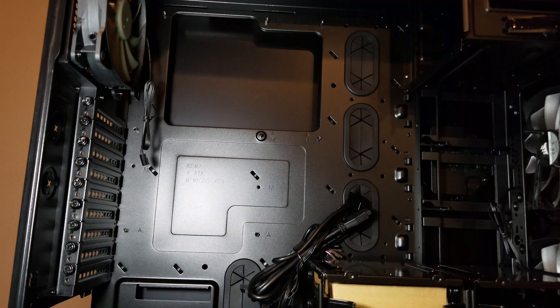Another thing to be aware of is the size of the opening at the top of the case — can you fit a cooler and secure it without taking everything apart? Up here there are openings that allow your cables to come through after the motherboard is installed. That space above where your motherboard goes is where your cable openings are, which helps with cable management and lets you route them through the back of the system to hide them and make everything look cleaner overall.